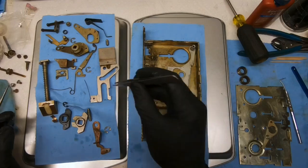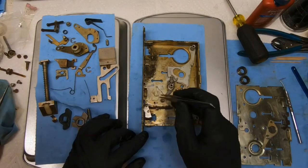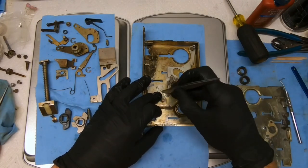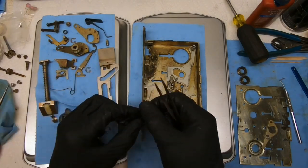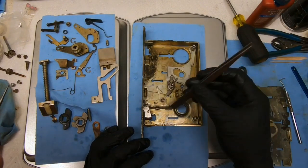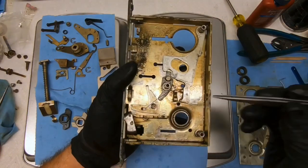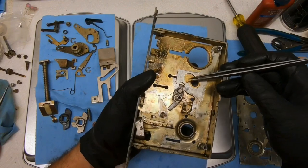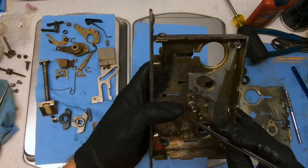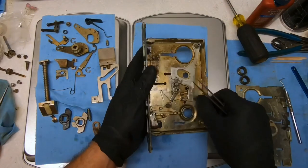Okay, was there a clip there? I don't think so, but let's see where that clip was. I believe it was. Holds that down. And then we had the two springs. Now, they were kind of wrapped around each other, but again, one of them was incorrect. I'm going to put this one underneath because it's so much finer. And it hooks into that and then wraps around with the little hook part. Right there, and the hook comes around and fastens in just like that, and then falls in the groove. So that would be correct for that.